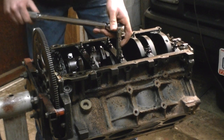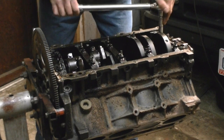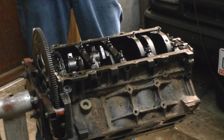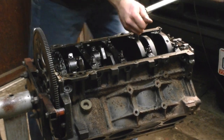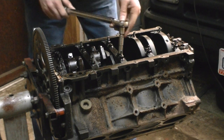Typically I try to do three passes of 20 foot-pounds, no particular method other than starting from the center. Stage two — and this is personal preference, there's nothing in a textbook saying this is the way to do it, this is the way I've had success — I'm going to go to 40 foot-pounds. And then finally I'm going to work my way up to 55. 55 is a good number. Starting in the center, working your way out.